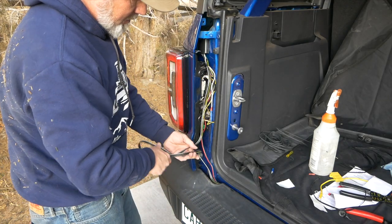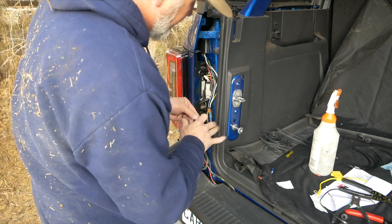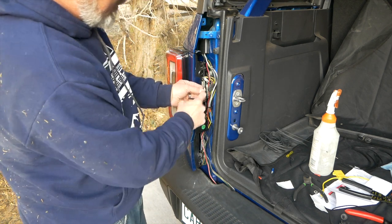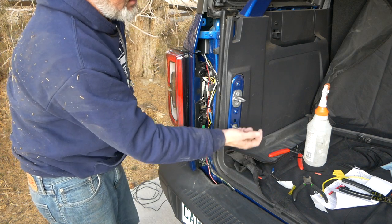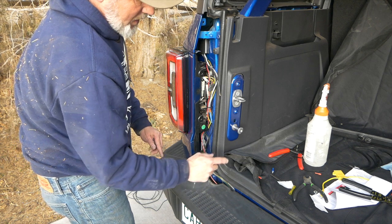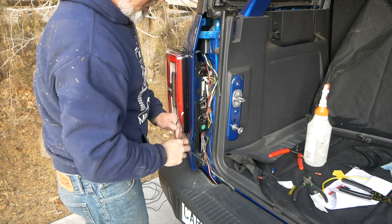The extra wiring harness for the trailer wiring I'm not going to be using any time real soon, so I'll put a zip tie around it so I can pull it out when I need it. I'm going to loop these two together — and that is nice and clean. The only wire I still have left is the power wire, so now we're going to run the power wire in. I tucked the bulk of the wire in through behind the axle, basically ran it up along the back side of the frame on the back side of the axle, ran it along the frame, and it comes directly into this spot right here. I'm going to take the end of the wire that I soldered and run it up along the loom that comes in — the loom stops right at the back frame right behind the axle. That's where it's going to pick up and run straight to the front.